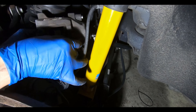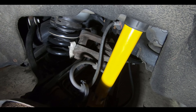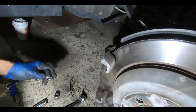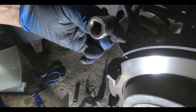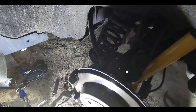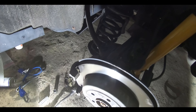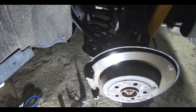These sliders seem perfectly fine — you can see they slide very easily, that's the way it should be. There's a little bit of tension but nothing that's binding. Otherwise, that's how you get uneven brake wear from left to right. So what we're going to do is hang the caliper up with a bungee cord on the suspension so that we have no tension on the brake line.